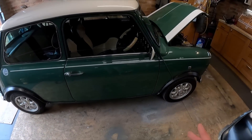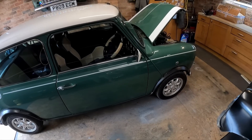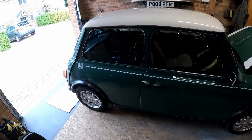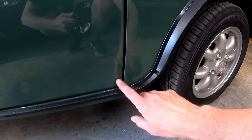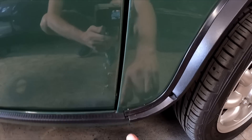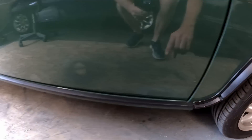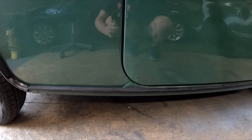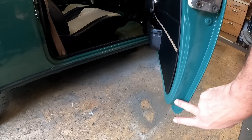The bit I need to sort — and it was disappointing — is the nearside door. I skinned that door during the build. It had a couple of spidery rust bits in the skin at the bottom which I thought were okay to clean off, cure the rust, and have painted. But the problem is, within a few months it had started to come through. There are a few rust bubbles down the bottom and at the back of the door. The rest of the door is pretty much perfect.